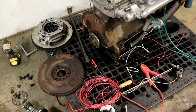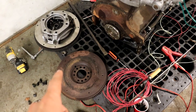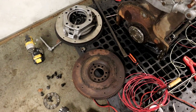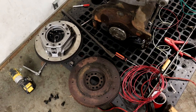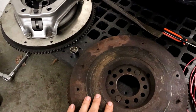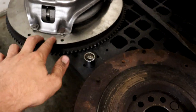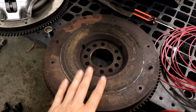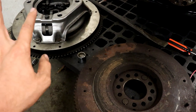After getting this though, I'm changing gears a little bit. I'm still keeping the same transmission and everything, but I'm going to actually use the Jaguar flywheel instead of the Ford flywheel. That's for a couple of reasons: number one, this flywheel is meant for that engine and fits much more tightly on the crankshaft. The Jaguar flywheel is definitely a much better quality product than the Ford flathead cast flywheel, which literally has visible porosity throughout the casting. So I'm going with this, which means I just have to drill a new bolt pattern in for the Ford pressure plate.